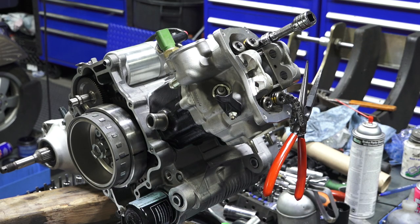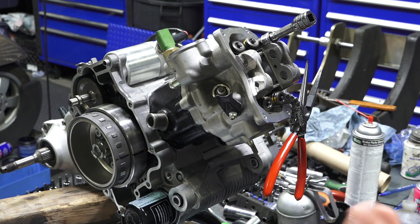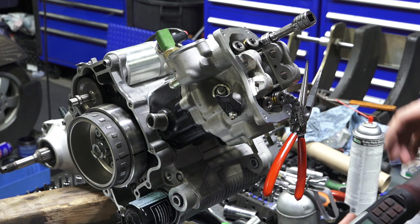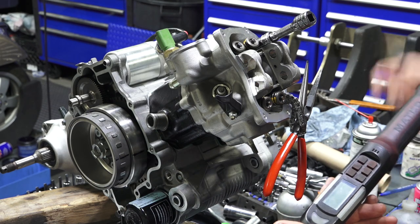And that's with new ones. If they're used studs, you only torque them to 7 Nm, you skip the 10 Nm, and then you do the 270 degrees. So it's a different procedure whether they're new or used studs.